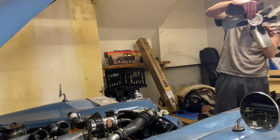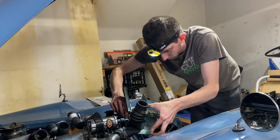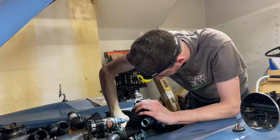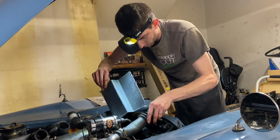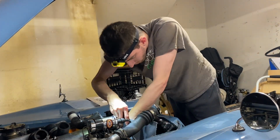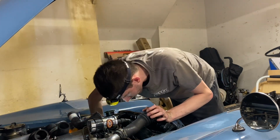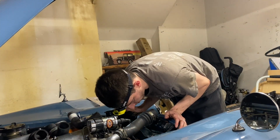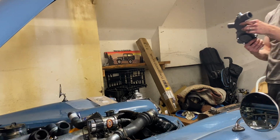So let's keep going. All right, so like I mentioned, we were gonna just tuck our fan in to the radiator shroud before we put the water pump in, just because of the spatial constraints. So you'll see me doing that right now. I thought I'd just do a voiceover to save the sounds of putting the radiator in and the metal squeaking against each other. So we basically just put that down there so that when we get the water pump on, it's not super tight trying to get the fan back in there. Maybe even impossible. It's pretty tight, honestly, once this whole assembly is in.